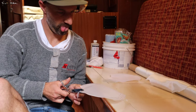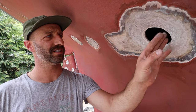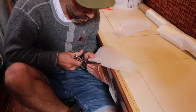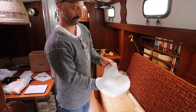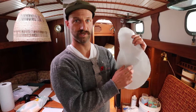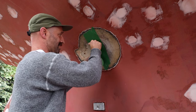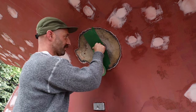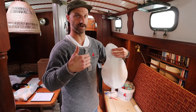Mick is working on the hole repair and he's got some fiberglass mat that he's cutting out. On the inside there's going to be about three or four layers, roughly this size. There's a hole there, so it's just going to be flapping about. I'm going to tape the outside of the boat so at least this can rest on. Once this is set, I'll pull the tape off, which will give me a good starting point for the outside, which is where I've done the most grinding.